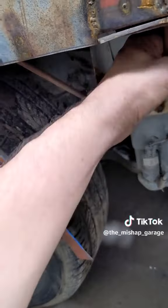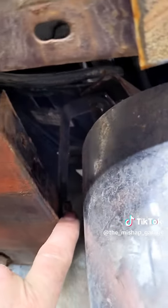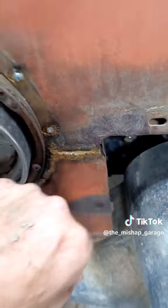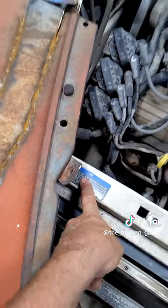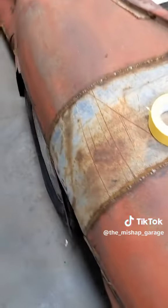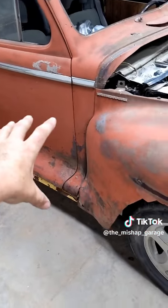This is only welded to this tab right here, which is bolted on. So as soon as I take these bolts out, this whole bracket comes loose. My other bracket is right there; that bolt goes back to another bolt back there on the original frame horn of the Buick. I will also be putting a bracket from here — I'll bend this guy down to right here — and the same thing will happen right there, so everything will still be removable.